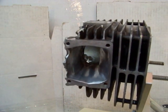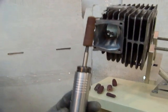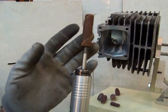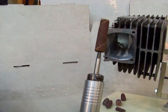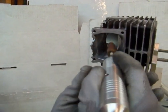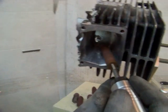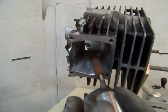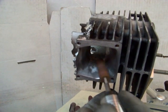The first way is fairly simple — that would be with a sanding roll like this, a cartridge roll. I like about 80 grit; you can use whatever you prefer to start out with. What we'll do is take the edge right here and just start working to give it a bit of a finish. Keep the sanding drum moving back and forth — don't stop at any one point or you'll start to build up.